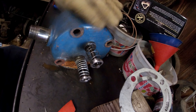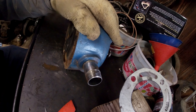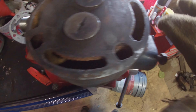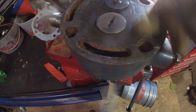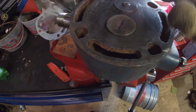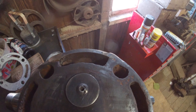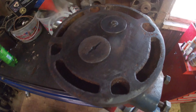We'll get this put back on now, and hopefully this will be a runner again by next spring. I actually decided before putting it back on to give it a few swipes with the file just to make sure we had a level surface — came at it from different ways to make sure it lays flat. Our brazed-up area felt like it might be a little proud of the head, but I think it's good enough now that any imperfections will be sealed by our gasket and that little bit of Permatex.